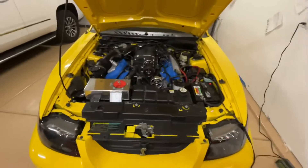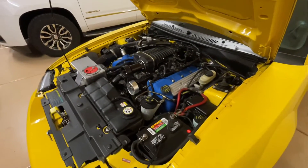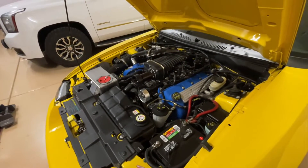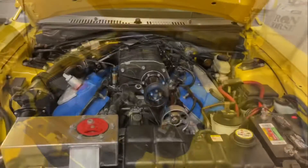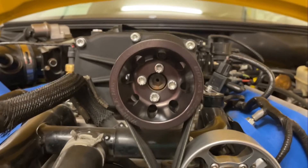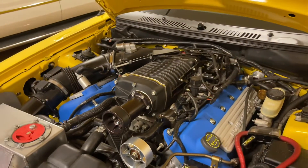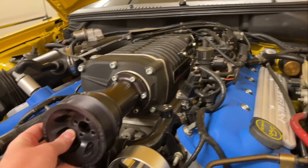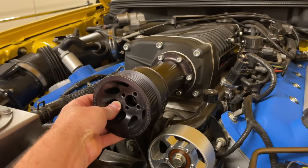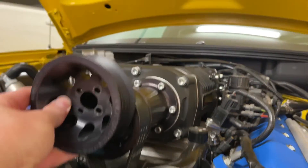The very first thing that comes to mind is how is that big blower going to fit under the hood? I like the stock appearance of the car, and I want to keep the stock Terminator hood. If you look at this blower on here — it's the 2.3 Whipple, a little bit smaller — it actually fits perfectly under the hood. With a 4-liter Whipple, the blower is so big and you have to run such a large upper pulley that it's not going to clear the stock hood. I'm definitely not cutting holes or notching my factory hood just to make the blower pulley fit.